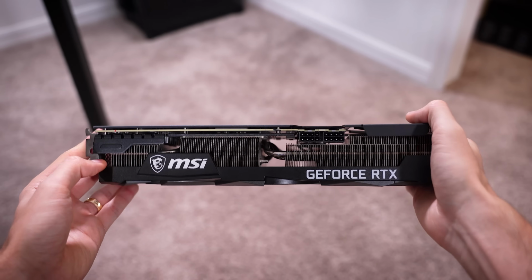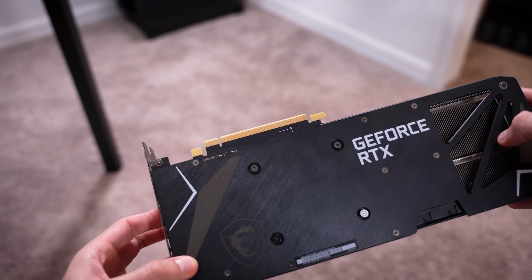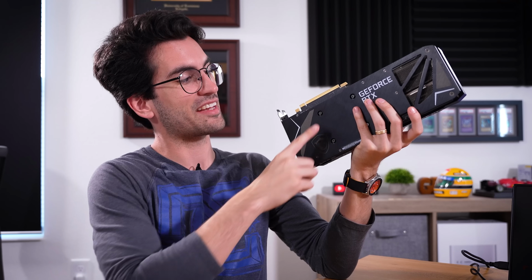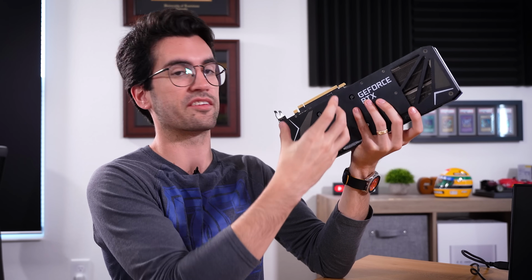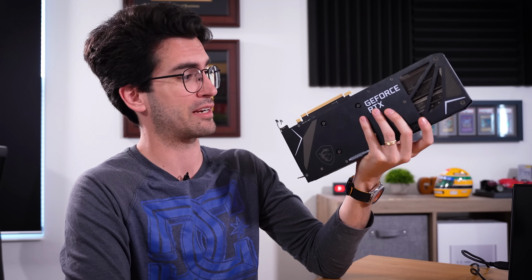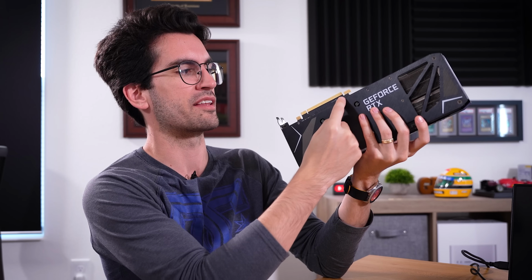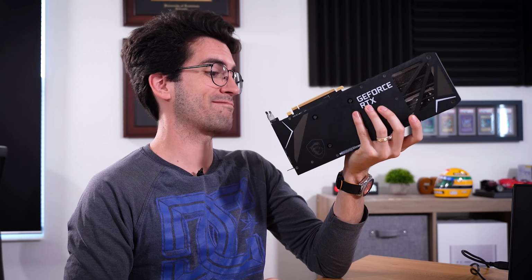Some of these newer cards here, they tend to hide the PCB fairly well, but I will say, especially around the golden fingers area, nothing to be all that concerned about. And I say that because during shipping, this area of a graphics card is stressed heavily. It tends to bend and flex with a lot of the stresses of being tossed around by UPS, FedEx, DHL, etc. They're all pretty bad about it in my experience. And so I wanted to make sure that we didn't see any cracking along the PCB. That could be an obvious reason why the card isn't posting. But so far so good.